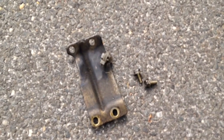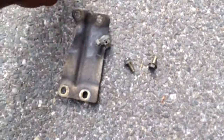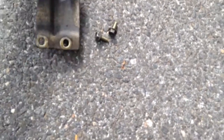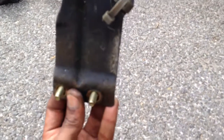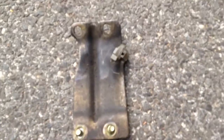When you're putting in that NWP spacing kit, this is the infamous pain in the ass bracket that's heavy and hard to come out. These are the two 12mm screws. They're gonna be on it like this, facing you something like this. Get these in here. It's gonna be at the bottom like this in a hard to reach spot. So what you're actually gonna have to do is, with that short head, reach around and get them from the rear. So that's the bracket.